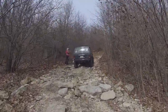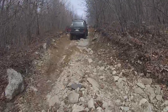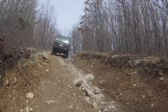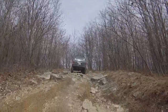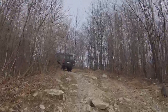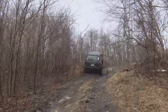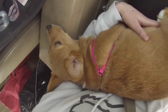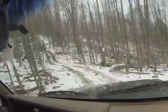If you're curious what size tires you can fit on this add-a-leaf four and a half inch lift — I started with 31s, then ran 32s, and now I'm on 33s. If you go to an 11.50 tire and wider, you're going to need a spacer or a wheel with offset because those tires will definitely rub your control arms. Anything 11.50 and wider, the tire will need to stick out more away from the inside of the body. Now, with the add-a-leaf, the 32 and 33 inch tires when the Jeep was flexing wouldn't have much flex before rubbing on the rear fender flare or inside of the fender. I fixed the sag issue with the lift block, which originally stopped the Jeep from rubbing 32s, but it would still rub 33s when flexing in the rear until we put the Rubicon Express springs in.